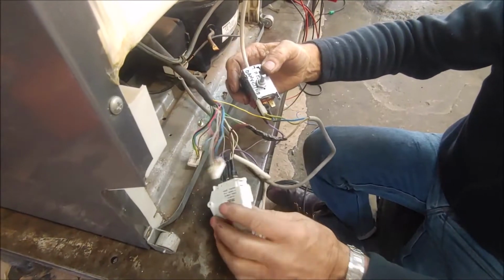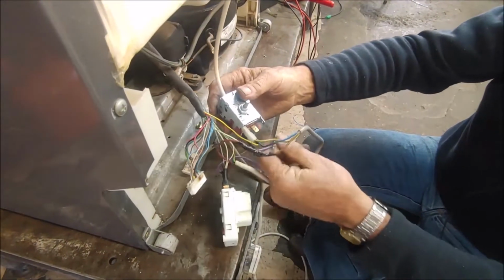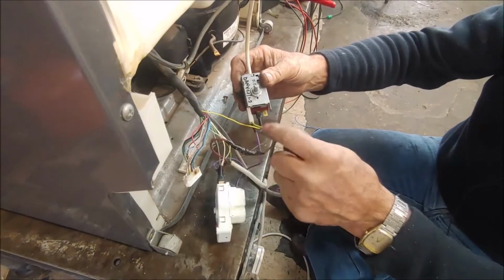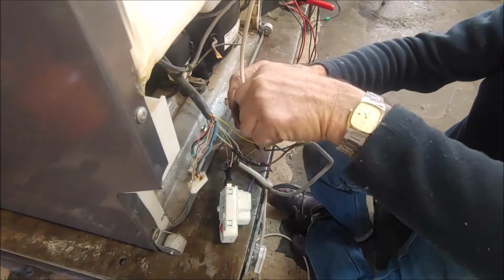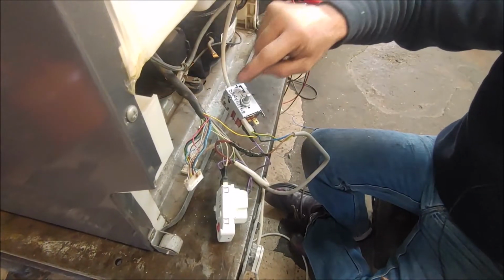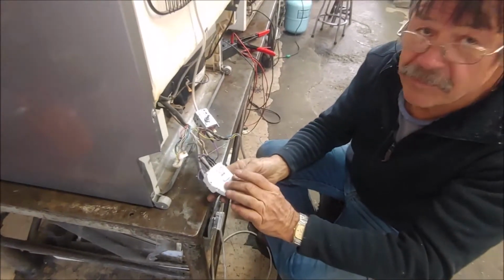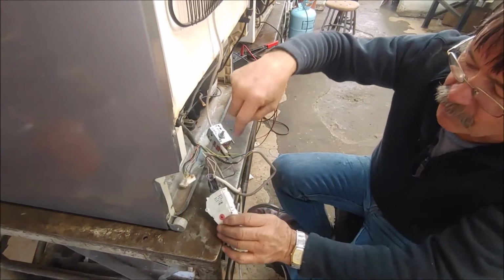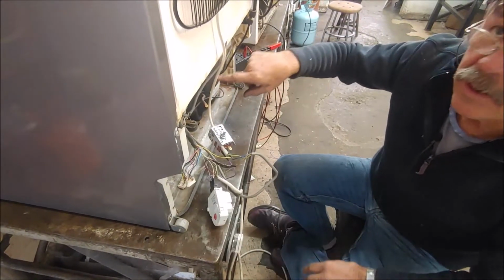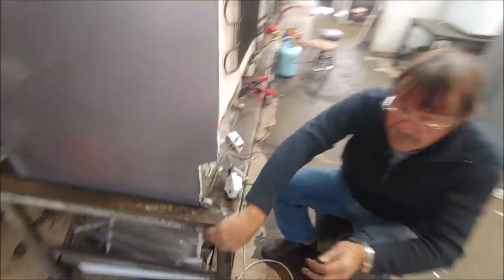And then the compressor gets broken. This pink wire is the compressor wire to the thermostat, and this blue is your compressor, yellow fan. So if this thermostat breaks, it will stop the compressor and the fan motor inside, or if it goes on defrost on the timer, it will break the connection to the compressor, but then give power to this little white wire to your element inside for the defrost.